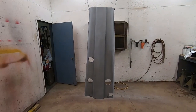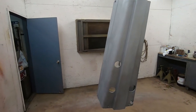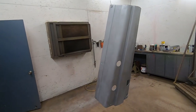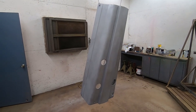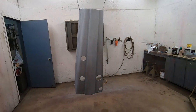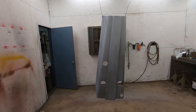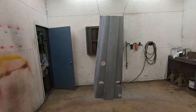up for him. They're going to cover some of it, but I am going to prime it with what I just did the last tractor in. I use SPI, which is Southern Polyurethane. A friend of ours got us involved in using it. I use their black epoxy primer, and then I use a high build primer on it, block everything, and then I just use John Deere paint.